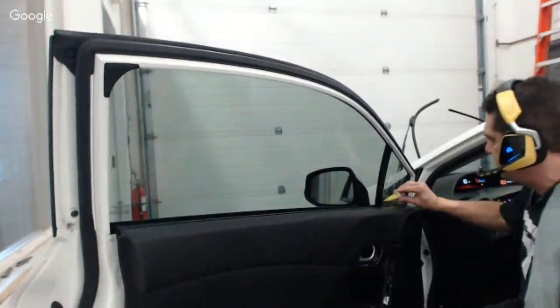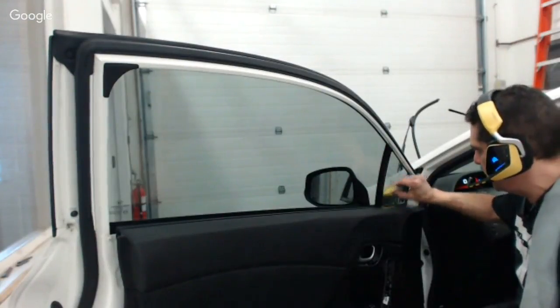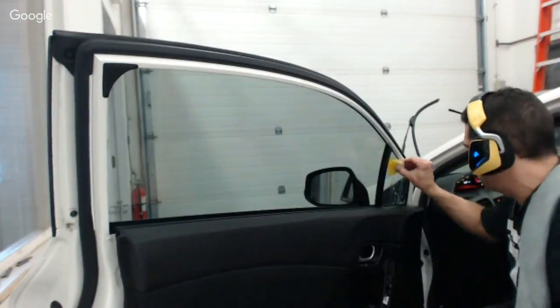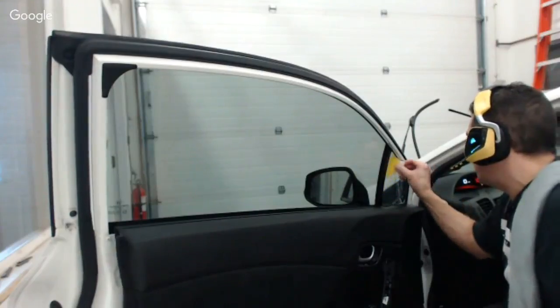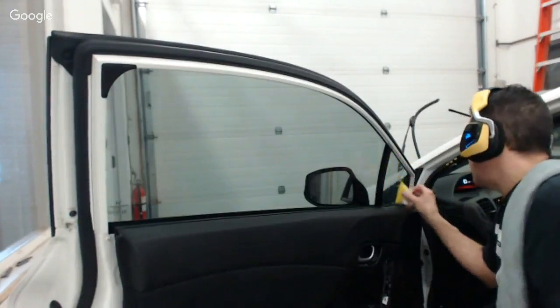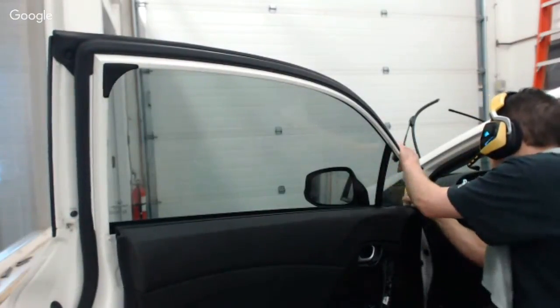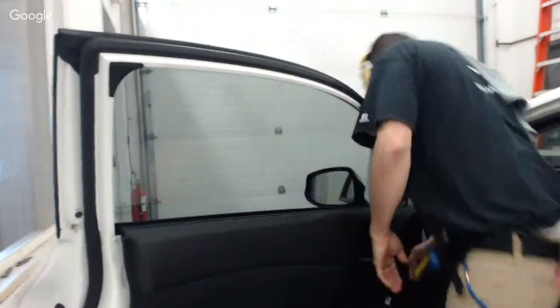First thing I do is tack it down. And it's tough for you to see, but just trust me when I'm telling you. I'm tacking it down, and I'm squeegeeing a little harder and a little harder where that ceramic lettering is. Most windows, small ones, have it. Utilize that. And I'm going up with my strokes for the majority of the back edge here because I don't want the piece to slide down and give me a light gap. So if I do most of my squeegeeing in an upward manner, holding the piece, double checking my edge.